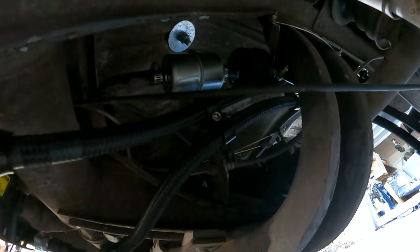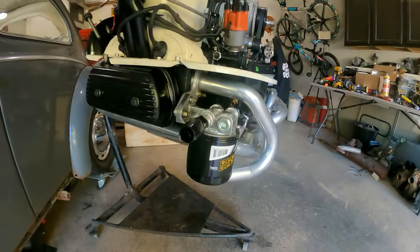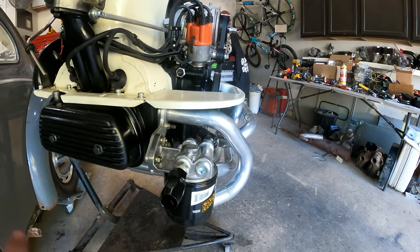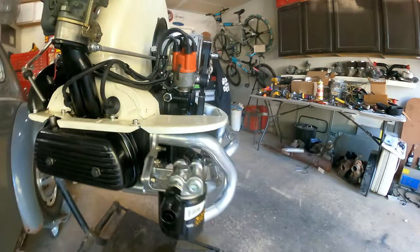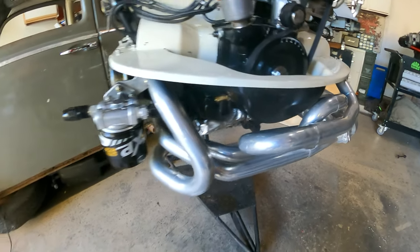Right there is the sensor for the temperature gauge from ISP West. These lines run up past the fuel pump connection. I need to arrange them so they don't touch, but I need the motor in to do that because I may have to shorten the lines just a little bit. On the motor itself, I have another 90-degree fitting if I need it — those lines should come up and 90 right into that. Then the other one goes back underneath, and we'll put some more of that spacesuit material over it so the header doesn't burn it.